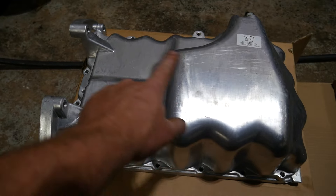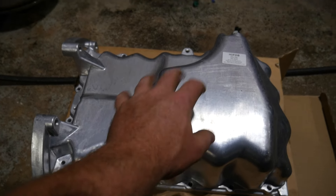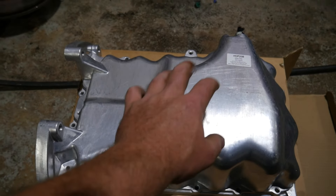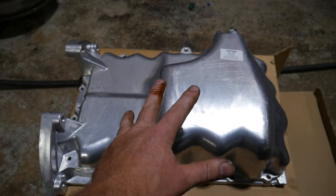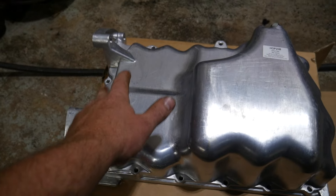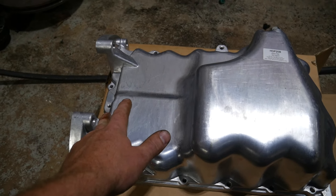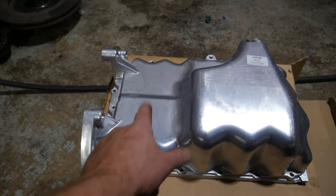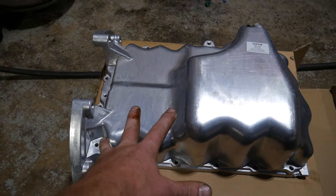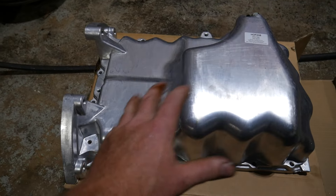On the new part, count your bolt holes. Make sure you have all the bolts out before you start prying on this thing, because these will crack. Particularly from personal experience — Chevy Ecotec — there are two hidden bolts, I believe they're 10mm, that go up into the engine. If you miss one, you'll crack the whole pan. So ask me how I know. Just double check. Make sure you have all your bolts out before you start prying.